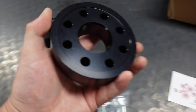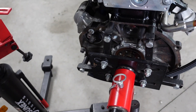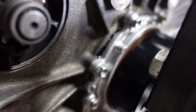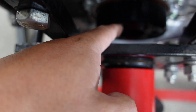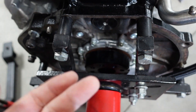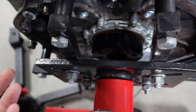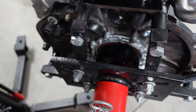This has enough pressure on it — that's all you need. If you really want to go crazy, put four in, but two is going to be fine. That allows you to pull the seal in. You have the mating surface side here — this is the side you'll put the bolts on, and the seal goes on the other side. You'd feed the bolts in and tighten them up, then get a wrench in here and tighten this up to pull that seal in. It's designed to fit around the crank so it goes in nice and tight. Really, really nice piece, and the fit and finish is just way too nice for a tool — but going above and beyond is what makes him special.